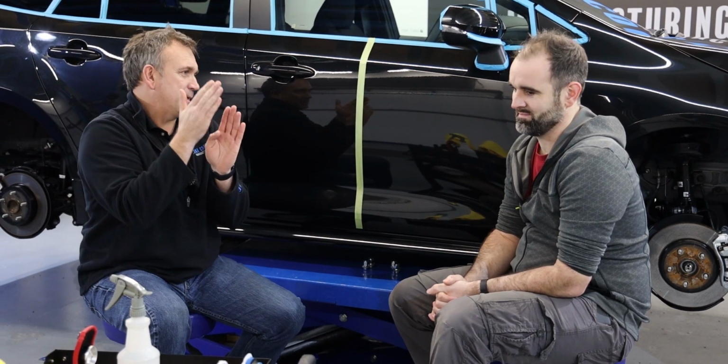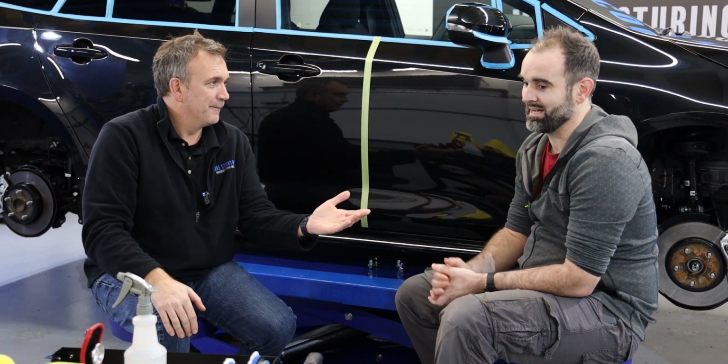I did explain to you, microfiber can be twice as aggressive as, say, a foam pad. But if you change your technique and method, and remember we said about the speed, you notice when I'm polishing with a microfiber pad, depending on what machine we're using, I've got the speed probably about a third of the way up the full range. So if you've got 0 to 6, I'm at about speed 2, which I think surprised you. I'm used to speed 4 on nearly every machine.